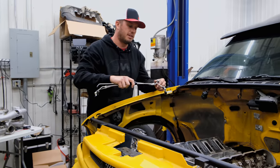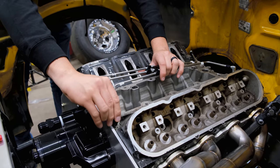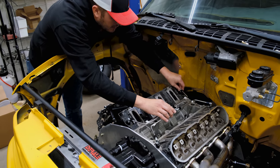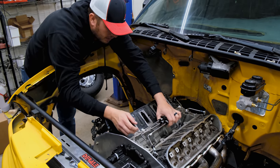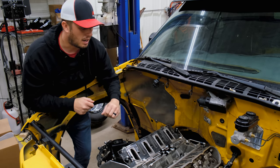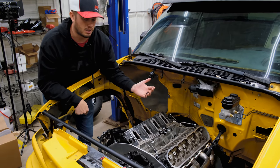Because this one is a taller style intake, our solid stainless steel one will work. This kit not only looks really cool, but it's really easy to install, it's pretty high flow, and it hides everything so you have no lines externally running. Obviously you'd have a valley pan here. You can see that all four corner blocks are connected, so it's taking the steam out of the top corner of each head so those cylinders don't run hot and lean.